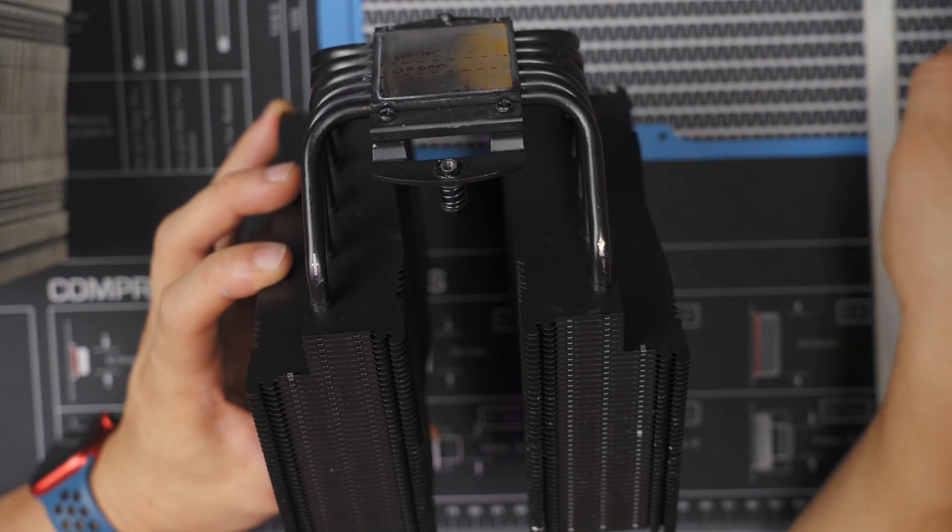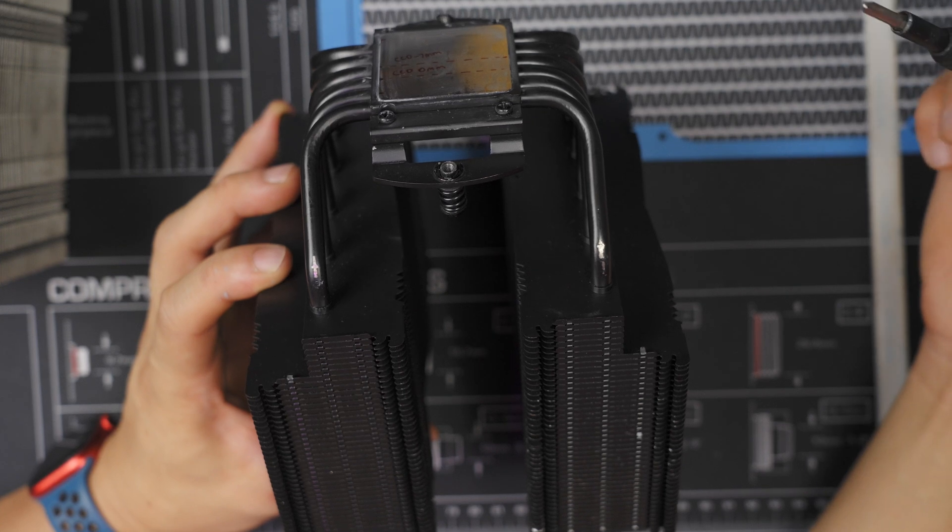It still fit, but that's not ideal. If you have a board with an even wider heatsink that could be a real problem. On an Asus board where the socket is already lower to begin with, it could potentially impede fitment of the heatsink entirely if it's wide enough. I don't have a free Asus ITX board to test — my Asus board is tied up in a custom loop right now — but I'm very curious about that and would appreciate feedback from anyone who can test it.